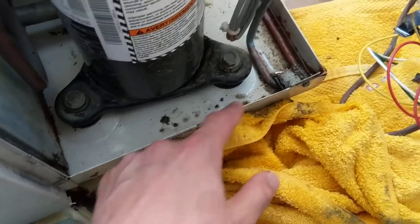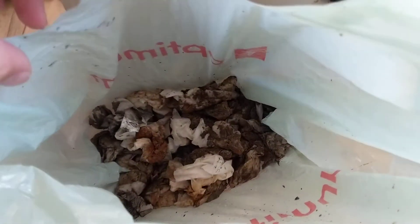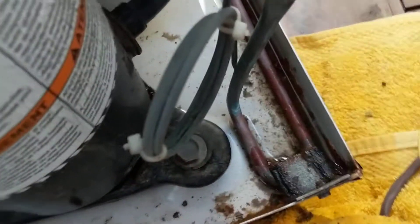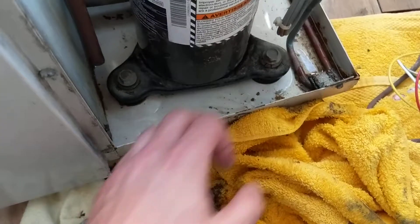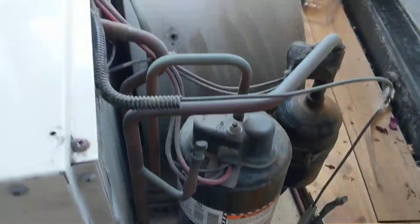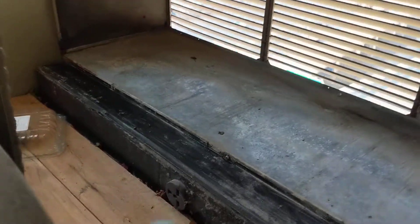In this particular unit, the heating coil was completely covered with debris — dirt, some Kleenex — it was substantially covered. So it's possible there just wasn't enough heat transfer from that coil to the water, so it was never boiling the water out. We cleaned everything, it's all nice and clean now, we're going to put it back in and it should be fine.